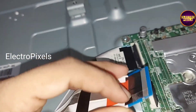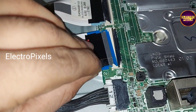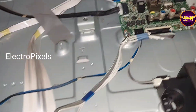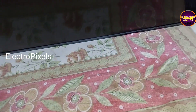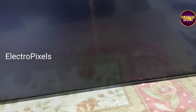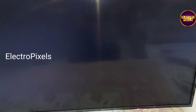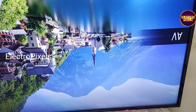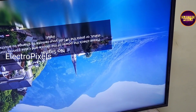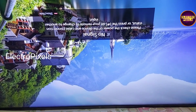If after blocking the right side gate signal the picture is not okay, then the problem is with the left side. If both sides of the panel are shorted then it is not repairable. After all, this is just a temporary solution — the permanent solution is panel replacement and we cannot predict how long the display will work using this method. See friends, now the picture comes and the TV is working back to normal. The shorting is removed and the picture is crystal clear.